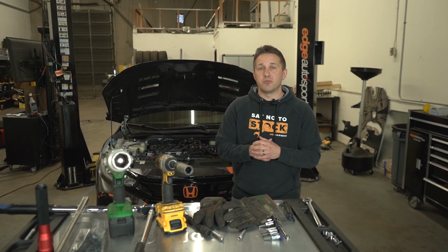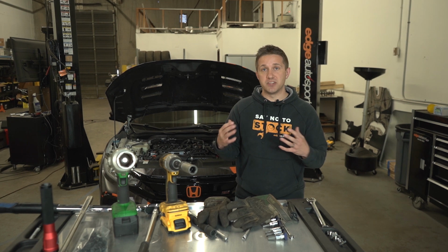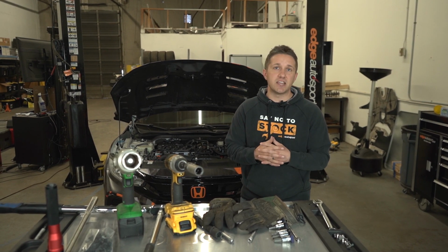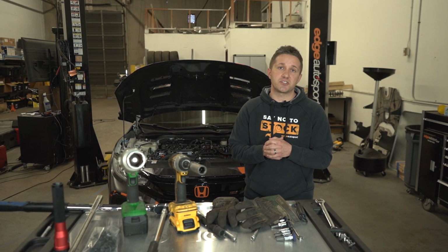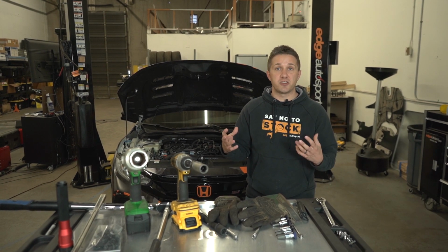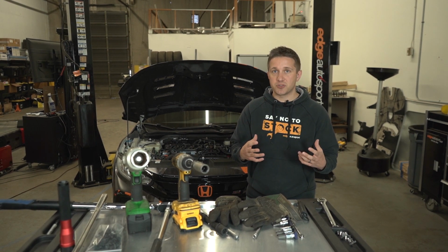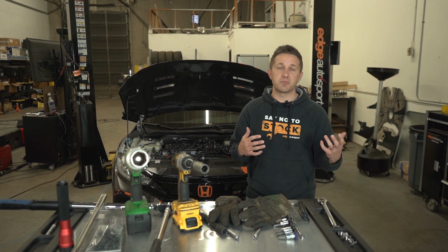So we're going to show you exactly what I'm talking about and what happens when you upgrade this car to a really, really stiff pressure plate, a harder to disengage pressure plate, like the Clutchmasters twin disc. And then we're going to go about the process of figuring out how to resolve that, figuring out how to have a much more direct fluid transfer system in the clutch master cylinder and slave cylinder assemblies.